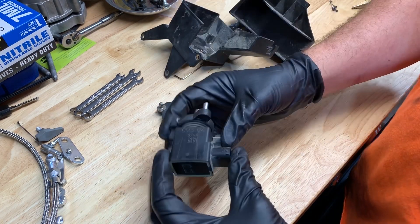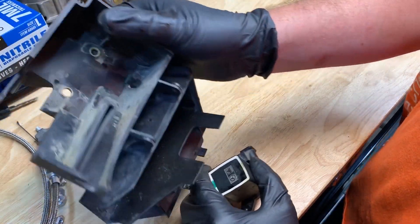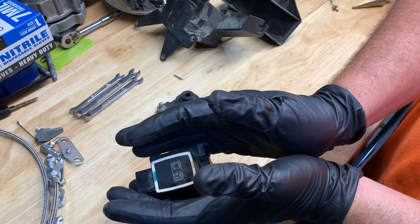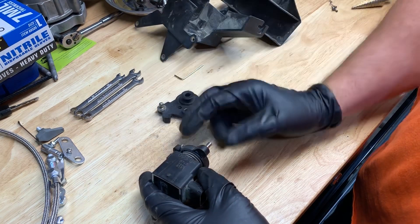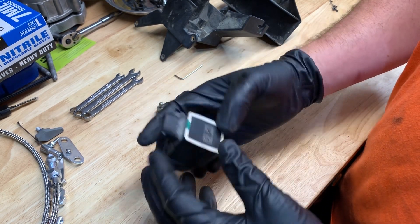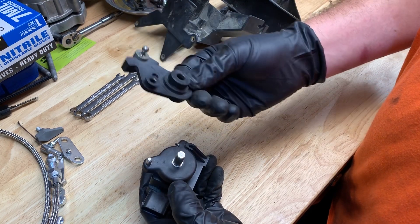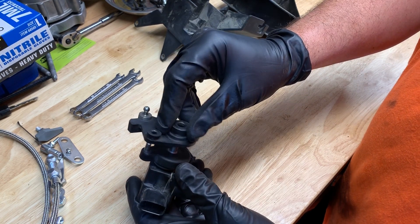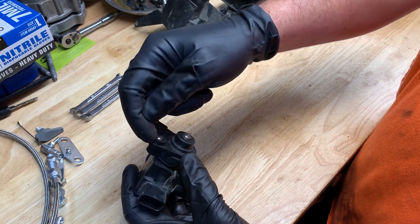This part number cross-references to early 2000 Mercedes-Benz vehicles, primarily SUVs, which have this exact same sensor with a different style throttle position linkage box. It won't look just like this, but it'll serve the same purpose — it's a firewall-mounted application. So if you cannot find a 2003-2004 box, please start looking in the import section for one of these out of an early Mercedes-Benz with the same resistance values. In the Hemi box, you'll have this cam bracket that fits on the throttle position sensor, and the return coil spring wraps around the extruded part and hooks around there.